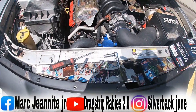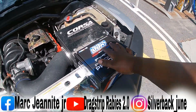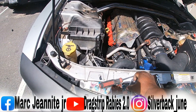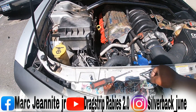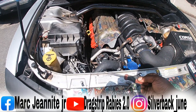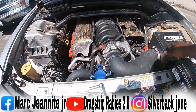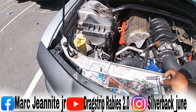Here are the tools you're gonna need: of course the throttle body, a 10 millimeter quarter-inch socket with a quarter-inch ratchet, an 8 millimeter socket, maybe a little extension, and a screwdriver. That's all the tools you need to take the throttle body out. You're also gonna have to take your intake off, but all you need is a screwdriver for that.